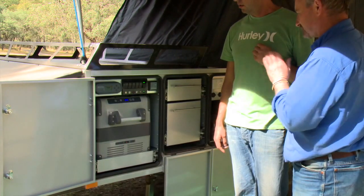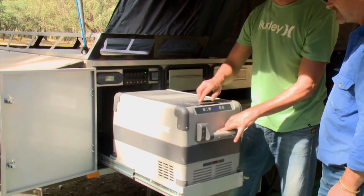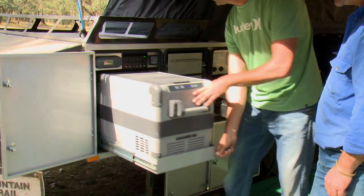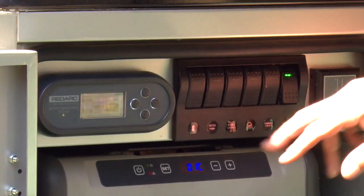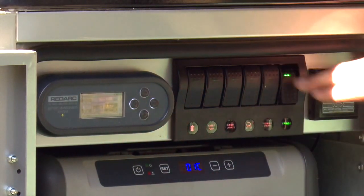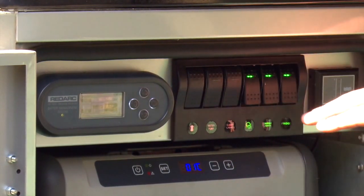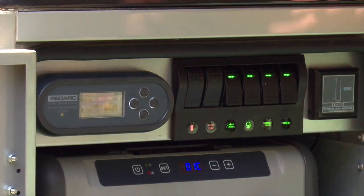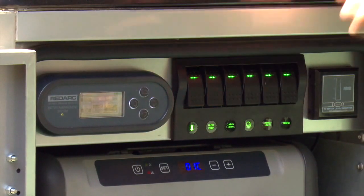Close to the kitchen is the fridge and your whole electrical system. We've designed it so the fridge slides out further than needed so the lid sits back and doesn't fall on your hands. Just up here is what we call the control centre — very simple to use. These are your override switches for power: fridge, courtesy lights for compartments around the other side, diesel hot water, shower inducted heating which is optional, and in 10 minutes we'll have hot water to the shower and kitchen. Cabin lights have their own switches, then water pump and electric set-up so it's ready for opening and closing.